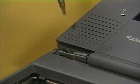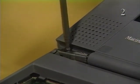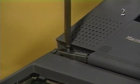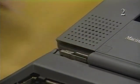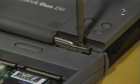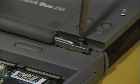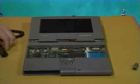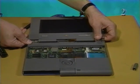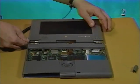To remove the display assembly, remove the 2 screws and the display mounting clips. Gently lift the display legs out of the holes in the stiffener, taking care not to damage the display cable. Rest the display on the support beneath it.